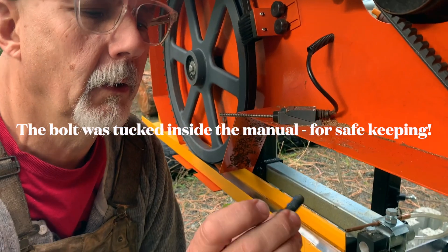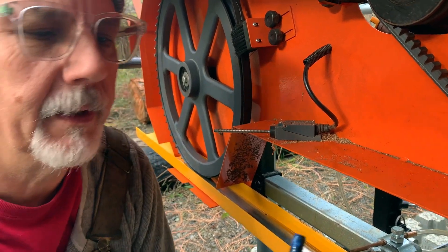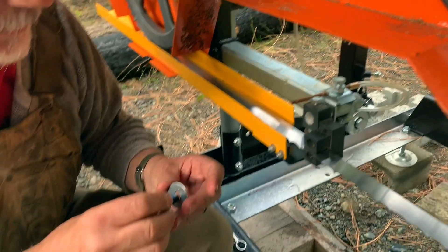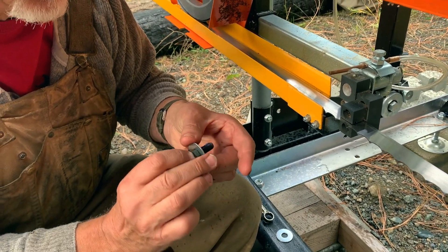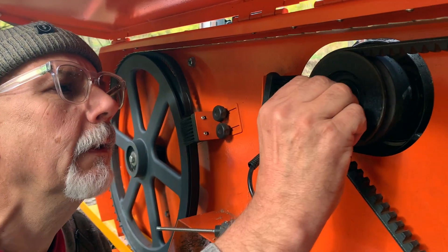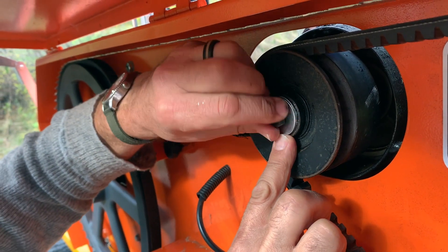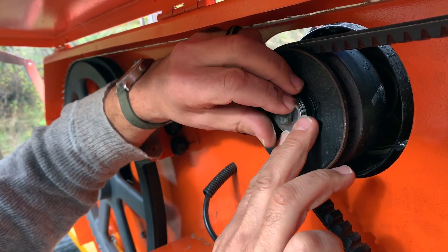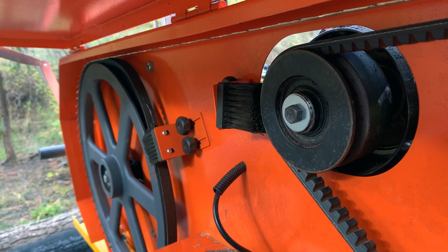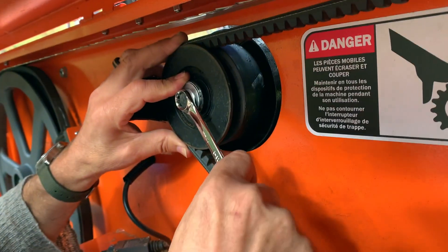After a moment I remembered I put the bolt in the folder where I have the manual. We got it. That fits through there — put that through there. We're going to double up the washers, and you know why? Because we can. Then I put it back in the shaft. My grandfather taught me this: you always hand-tighten it first. Lots of young punks just put the impact driver on it and go to town, but if you've got it cross-threaded that's a problem.